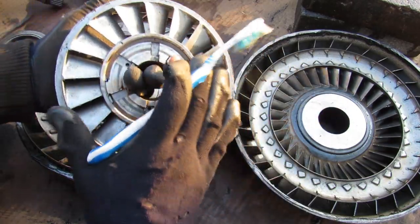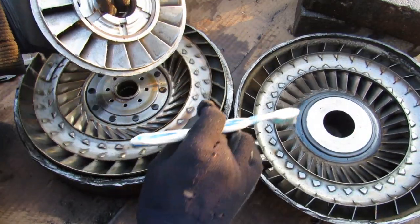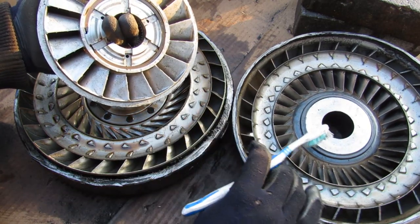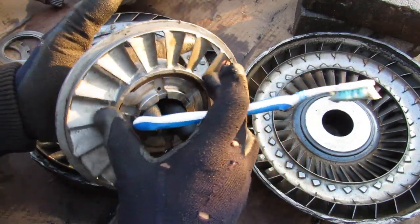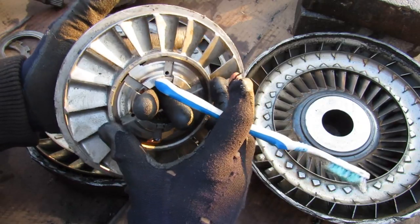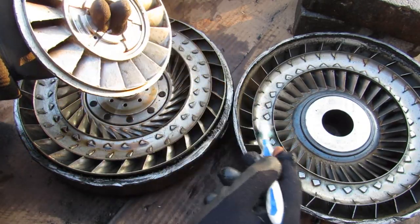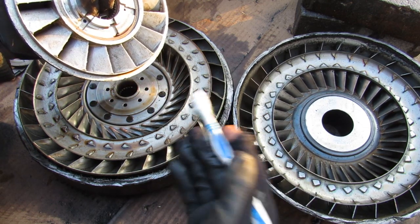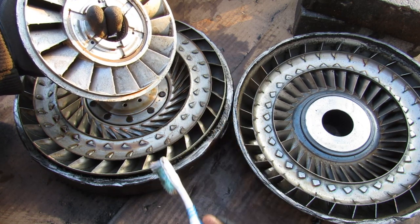The second main function is torque multiplication. That occurs when there's a large difference in speed between the engine rotation and the turbine rotation, such as when you just release your foot from the brake and step on the gas during acceleration. That large difference in speed creates a very large force on the stator which goes against its one-way clutch and locks up, forcing the fluid through it and back into the transmission pump. That force creates an additional torque — called torque multiplication — to help the vehicle accelerate off the line more quickly.